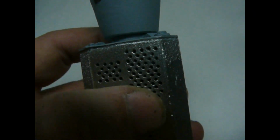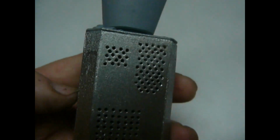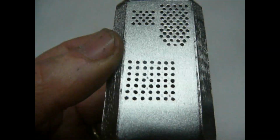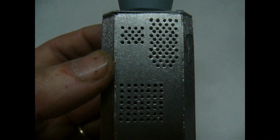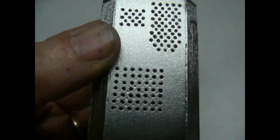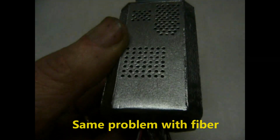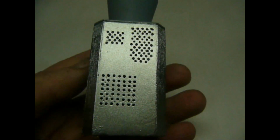I'm just going to fill the tops, I believe, because it makes it difficult to paint once these things are filled. You can't paint it again silver if you want to touch it up, because you'll spray right over the microcrystal clear and mess it all up. So it's nice to keep them open until the very last minute, and then you can fill whatever you want to fill.